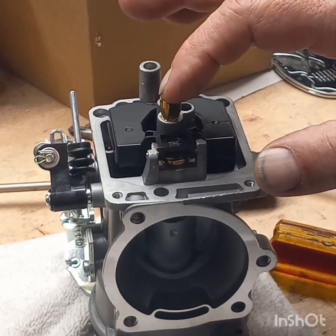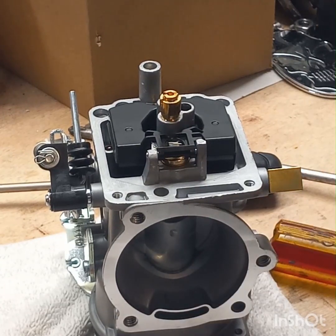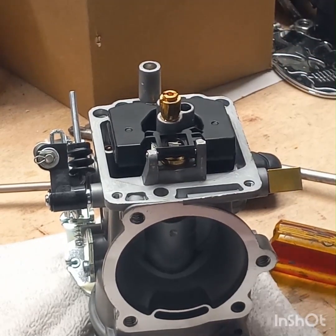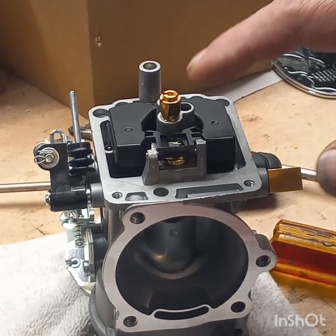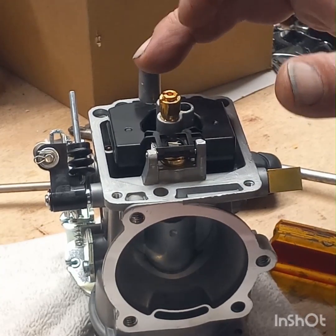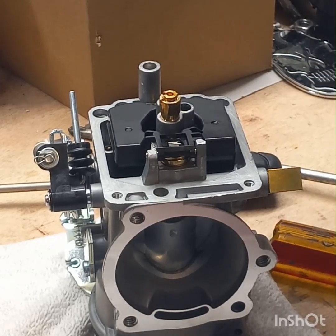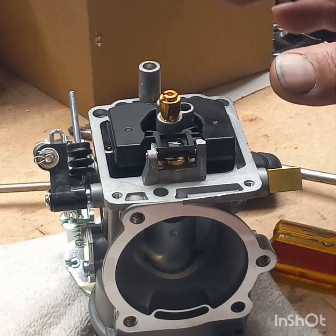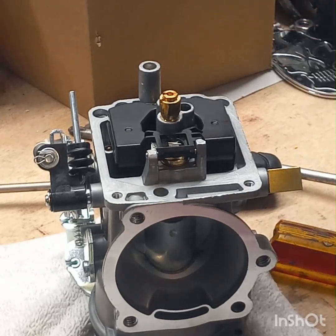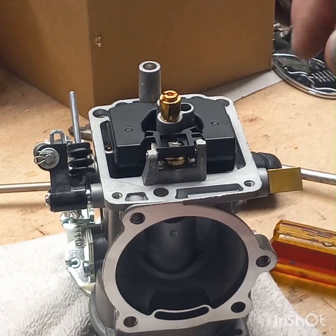And that's a 170. I'm actually going to run this the way they've got it set up. I've watched, I can't even tell you how many videos on how to tune these carbs and how to hop them up. And the general consensus between most of the guys that want to hop them up is to make the big jet 180 to 185, make the little jet 46 to 48. And usually the mixture screw is, like I said, set anywhere between, I'd say 70% of the guys say between 2 and 2.5, and the other 25% are between 2.5 and 3. So that's why I said I was going to set it between 2 1/4 and 2 3/4 in there. But we'll start with the 2 1/4.